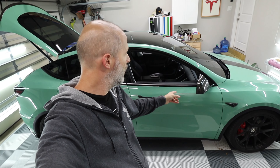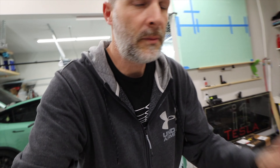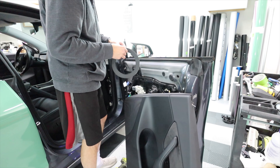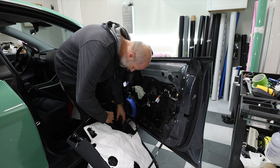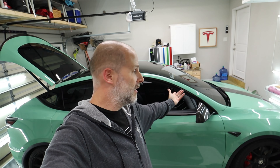So you saw that door was not very hard to do. It's just that one door speaker down here, and then the tweeter — you get this foam to wrap around the tweeter. Because the tweeter that comes with the Tesla has some tabs that just kind of hold in place, and if you break this off it doesn't really break off, it just comes off. So you have that foam to go around that. I took this ring and put it around the inside of the foam, inside the door panel, so now it's going to concentrate the air and the noise out of the door panel itself, and it helped with vibration as well.